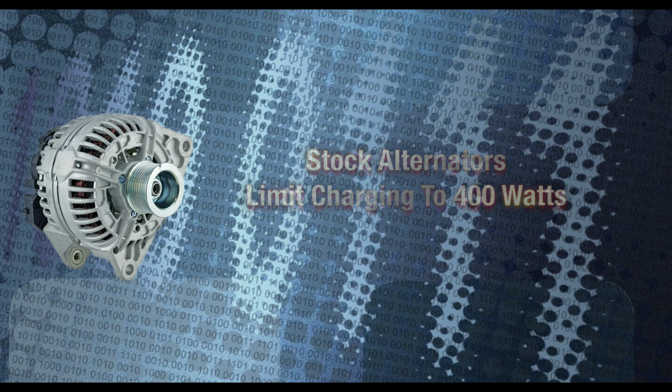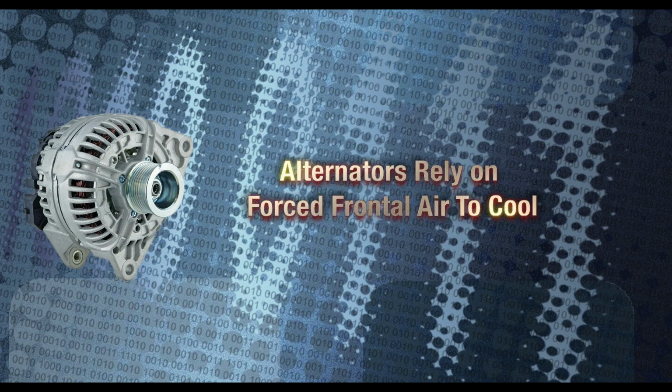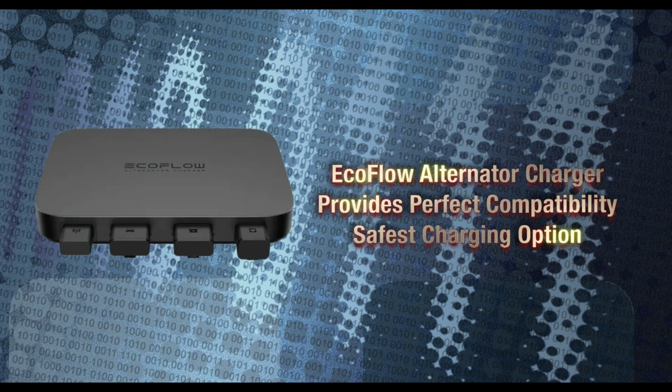Also avoid charging anytime the vehicle is stationary. It's the worst thing you can do to an alternator. Alternators rely on forced frontal air from movement to assist the internal fan and transfer heat from the alternator's windings and case. Finally, while there are less costly alternatives using the XT60 ports, the Eco Charger provides compatibility and safe charging of EcoFlow power stations.